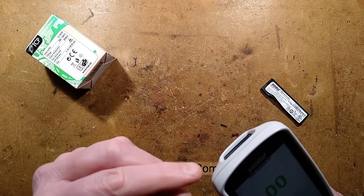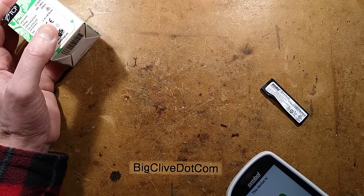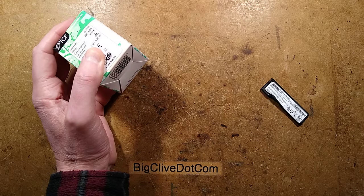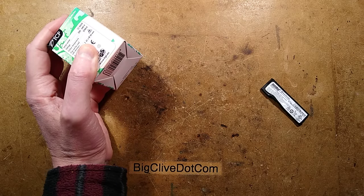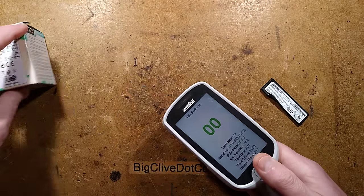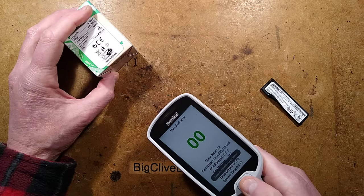It's an LED up here and there's a light source, then a camera. As long as you get within about half a metre - that's about 18 inches - of a barcode, it will scan it. But if you go too far, it will light but not scan. It's getting a decent range - better range than before. It is roughly about half to three quarters of a metre and you can keep scanning, but after a while it's just going to take the hump and not scan anything any more.